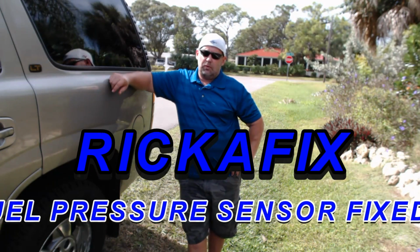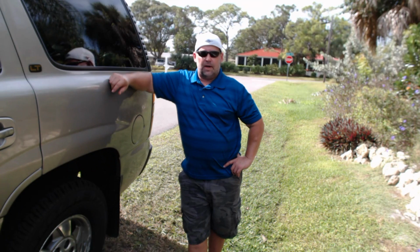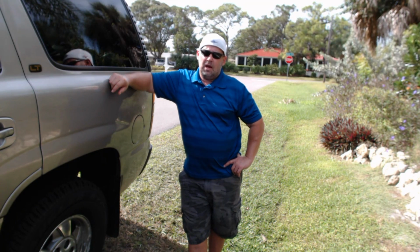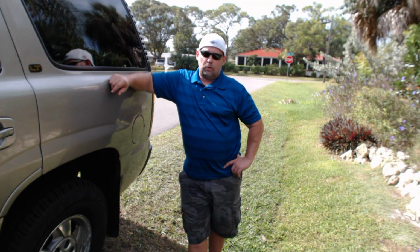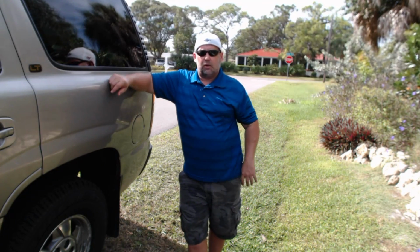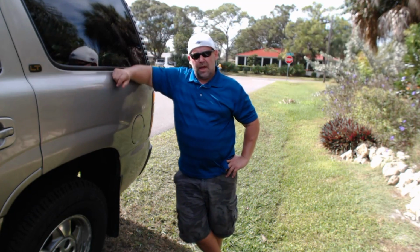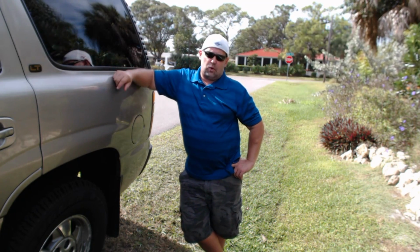Hey, a couple months ago, I replaced my fuel pump and immediately got a P0453. My pressure sensor was throwing a high voltage, and so I let it go for about a week to see if it would fix itself, because sometimes they do that. And unfortunately, it didn't.